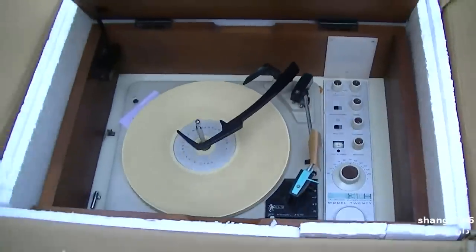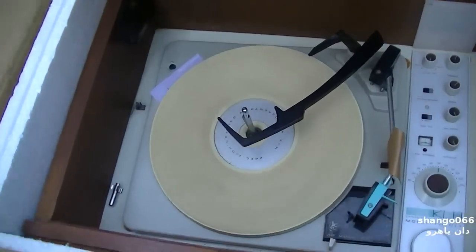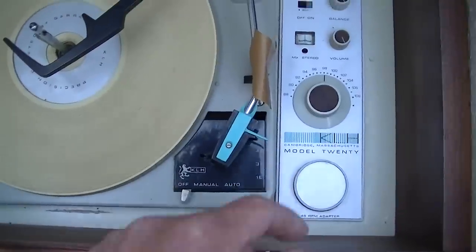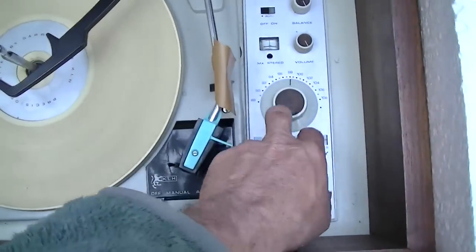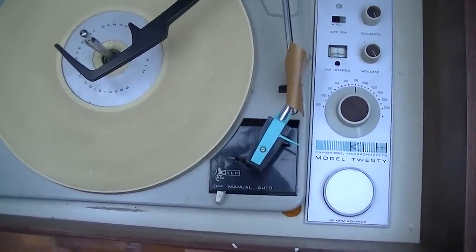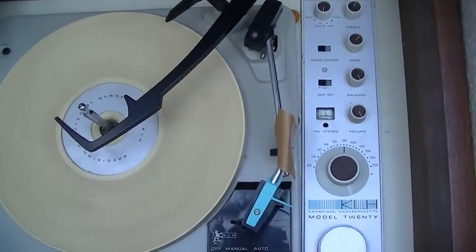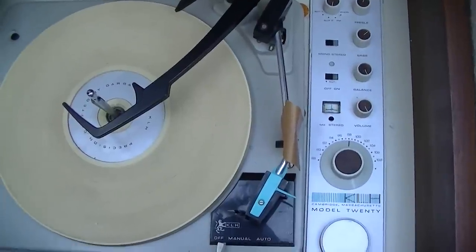These are really, really good turntables. A bit of a cult following, but well deserved. And they have a couple chronic problems, which are the RF amp. These are all germanium transistors, even the outputs. The RF amp goes bad in the front end of the tuner, and he said that he turned it on and there was a loud buzzing and then a pop and then nothing. So that to me initially sounds like a shorted output transistor and then a blown fuse. But let's not assume anything.